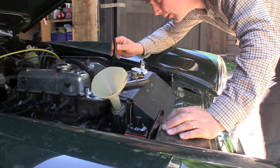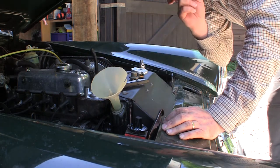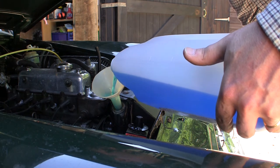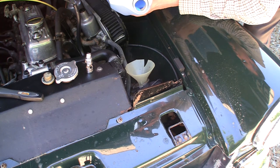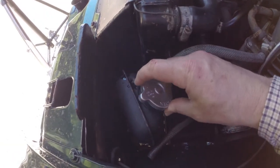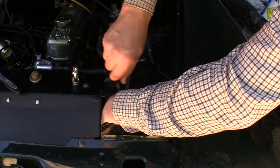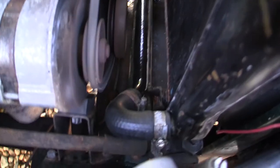I've disconnected the hose from the expansion tank — that just needs to be lifted up so it can fill above the filler point. Fill this as hard as we can, then we've got to put the coolant into the expansion bottle half full, reconnect that hose and we should be done. Difficult to see when this is half full. Reconnecting the hose to the expansion tank.